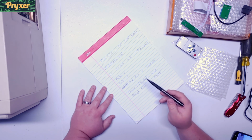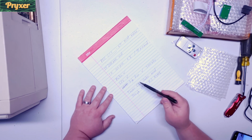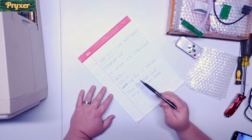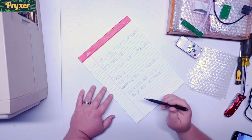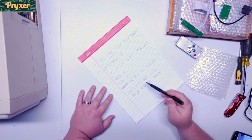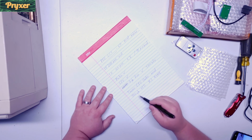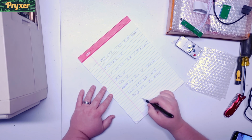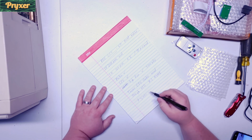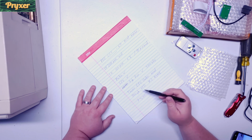So that should be plenty. So we got RAM, we got a CPU, we got a motherboard, we have two graphics cards to choose from. We need a power supply. We need 3 fans total, two 120 millimeter and one 200 millimeter. We need to get a tower cooler, like a 212 or a 212 clone, for the CPU, and we need to get the SSD. Hopefully, I think I can get everything that I need for 300 bones or less. So let's make that our challenge to keep it under that.